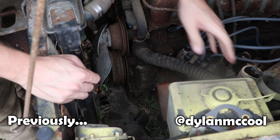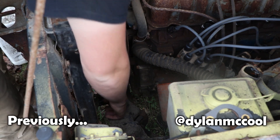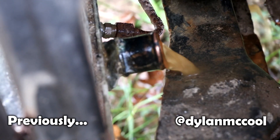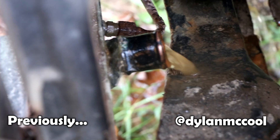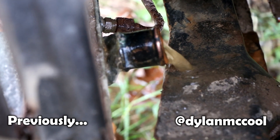There's a little bit of coolant still left in there, the hose is wet. That will be going into our engine, so we're going to flush this out the best that I can until it looks fairly clear coming out the other side.